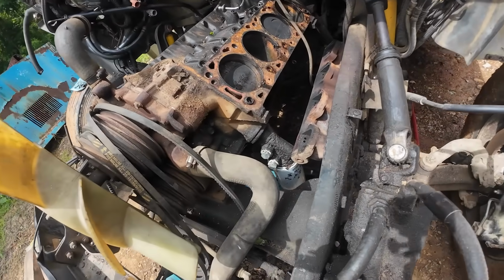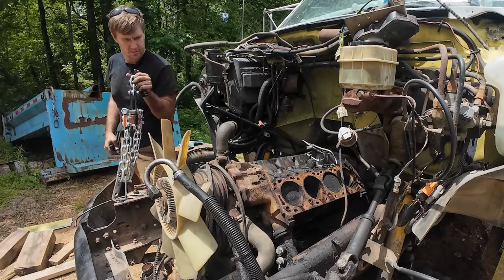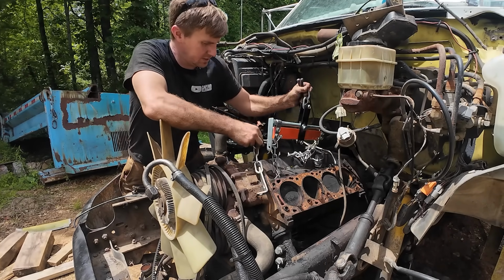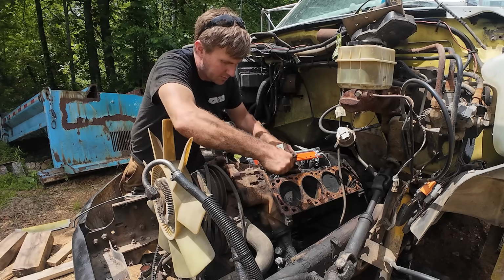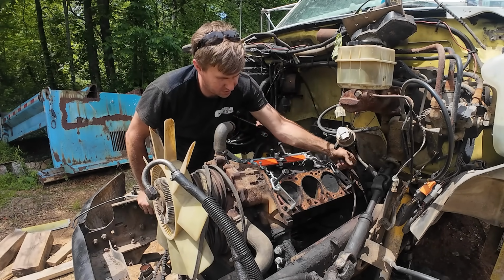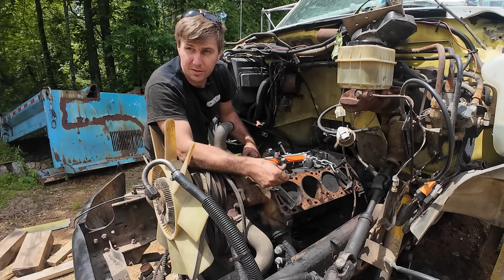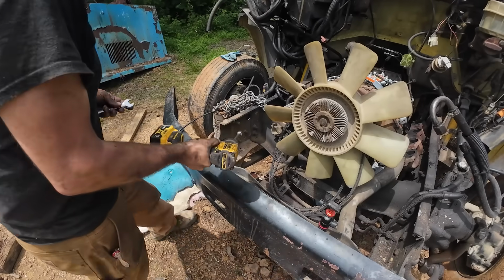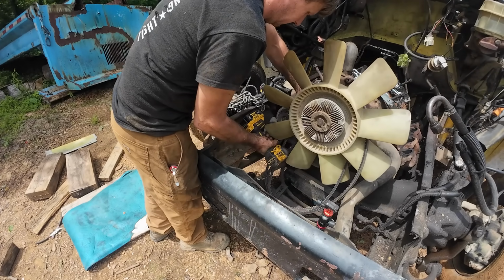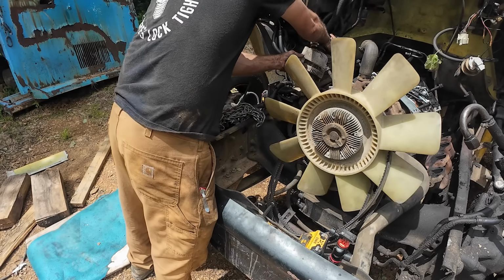So in theory, we're gonna take an oil filter off too, so we're not fighting it on the way out. In theory, so this is the bracket off of my engine lift, and I'm just gonna use it because it'll give me a little bit of leveling capabilities. Hopefully the tractor can lift the block. I mean, there's no heads on, there's no intake. If not, we'll go get the bigger engine lift. We've got a bigger one, it's just, let's get a few more things out of the way. We'll go ahead and take the alternator off of here. Sling it over here.